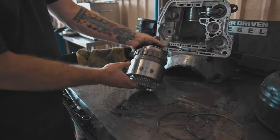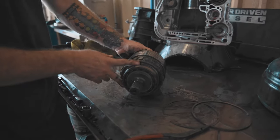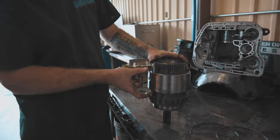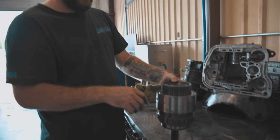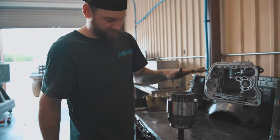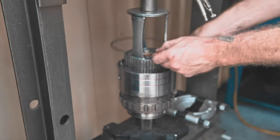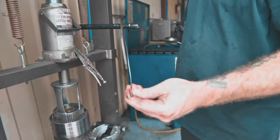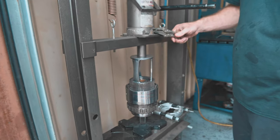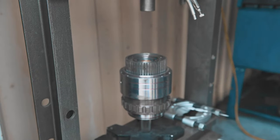This is your overdrive direct. This is kind of like a grenade, for lack of better words. Stock output shaft - that'll change. There's a great big huge honking spring in here, he's like this big around, he's about this tall. You compress this and there's a snap ring in here and that whole thing - 800 psi per inch. Like a big spring. So it's a grenade. We'll do it the right way. So you got the big spring here. This guy always gets replaced - he's known for breaking. He's wavy, so he's a spring. And you'll see these break in three or four pieces all the time. That's the first stage, if you want to call it that.